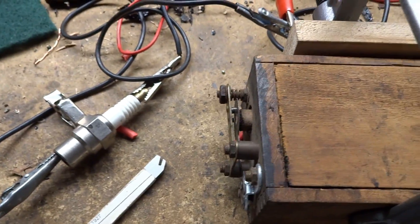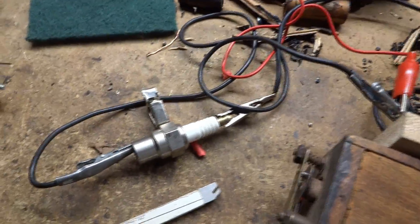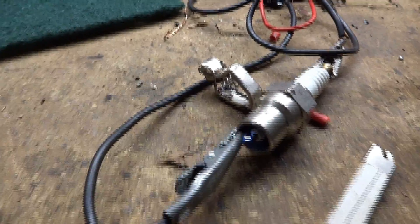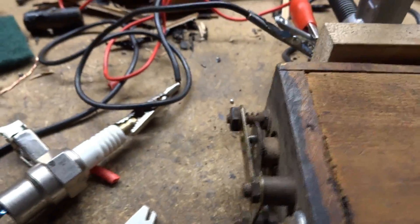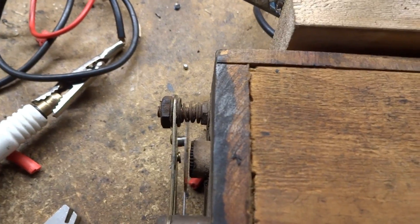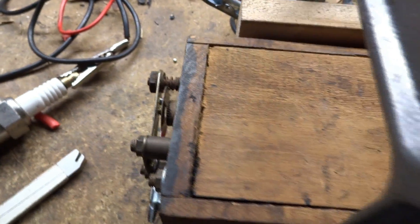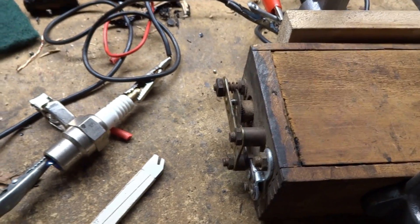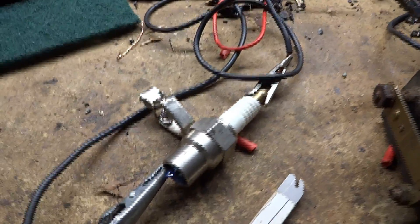I'm going to show you what this coil looks like now as far as generating a spark. You remember that kind of faint hiss — it did create a spark, but on a much smaller plug. Here we're on a test plug and you can hear it now. It's obviously a much brighter spark — solid and hot, going right into the ground. Then you come back over onto the coil and you see very, very little — just a faint amount of arcing between the two points. I've set enough of these by sound; if that sound is about right, it should be drawing about an amp, maybe an amp and a quarter. Again, this is on a 6-volt sealed lead-acid battery.